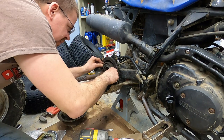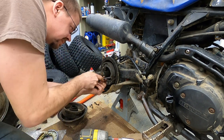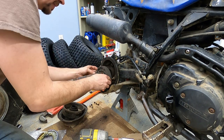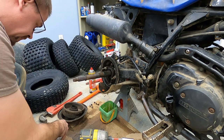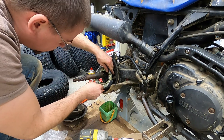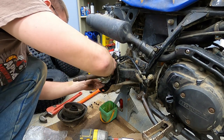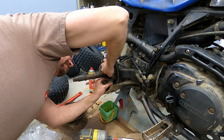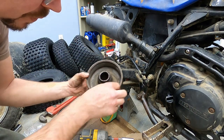Now these guys you just simply got to pull apart and slide them out. Come on - there we go, off with the old. Slide our new pads on. Of course these springs are going to be a lot more hefty. It's probably an easy way to do this - I'm just going to hillbilly it until I get them on there. There we go. Still got a pretty good bit of liner in there.